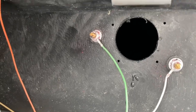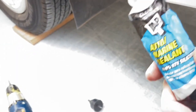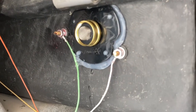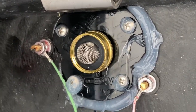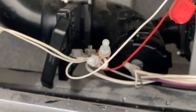We've got our holes drilled for the screws. I'm just going to use this automarine sealant — 100% RTV silicone. I used this on a boat project, so this should be pretty robust for this application. I'm just going to coat the inside of the Tornado all with this, the screw holes as well, and I'll screw it up. It was lathered in silicone, now I just pushed it up there, putting the screws in to screw it down. You can see the silicone's kind of seeping out. What I'm going to do is — they said to open the black tank — so I'll just pull the handle, leave the cap open, and just kind of let it sit for a day so the air gets in there to dry it out and let that silicone set up.